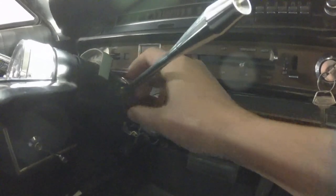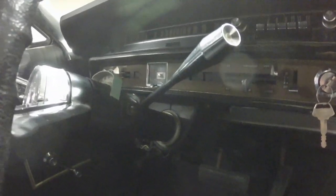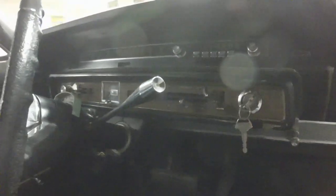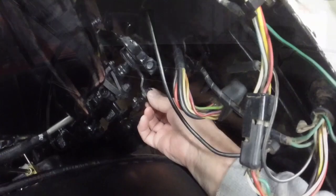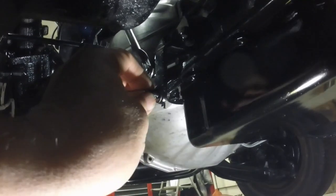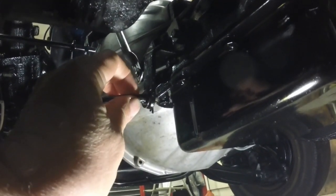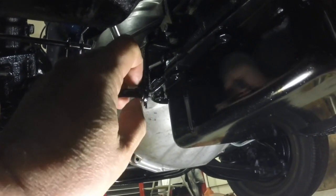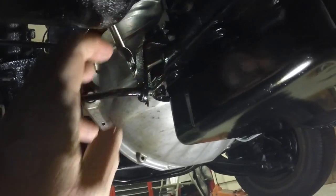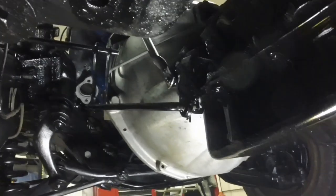Also, this lever — there's a little metal thing in there that's missing, that's why the lever's loose in the column. I'm going to be taking that out for chrome plating and I'll address that when I take it out. This is the shift linkage right here, and this is all nice and tight. You can see down there the bell crank — everything is nice and tight. This is where the linkage attaches to the transmission, and that's where I can actually move things a little bit. I'm going to take that out and put a little spring clip in there that holds it tighter. I've got all these little brass sleeves so I can sleeve this so it fits nice and tight so the column doesn't have slop in it.